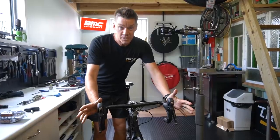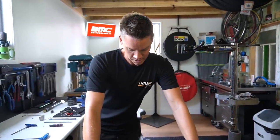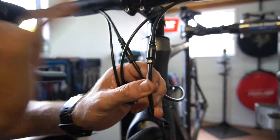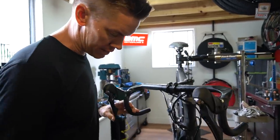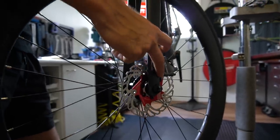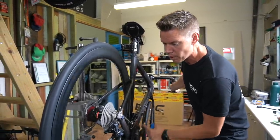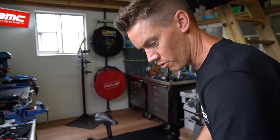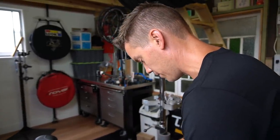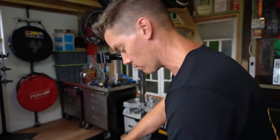The brakes are the wrong way around — which means it pretty much doesn't pass Australian standards. Most bikes won't have these horrible connectors, which are annoying because they rattle terribly. Setting up the brakes and the caliper where it's mounted to the fork — the faces of the fork itself are not square. That disc rotor has a kick in it. We're going to have to sort that out. I'm going to try and fix the caliper mounting area because it's not made very well — you have to face the fork. The disc brake caliper mount is on the piss big time, so your brakes are rubbing terribly.